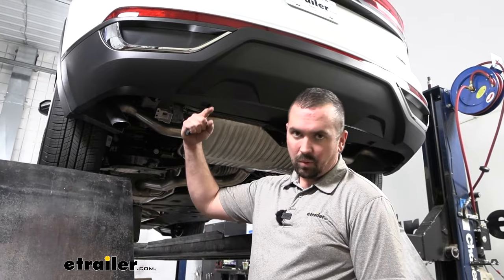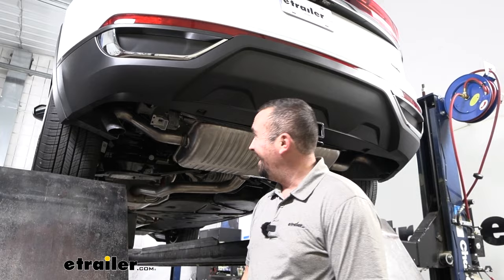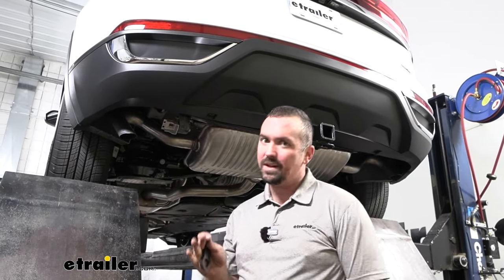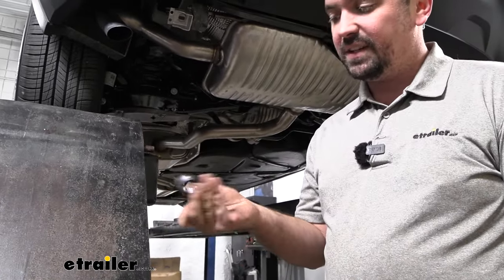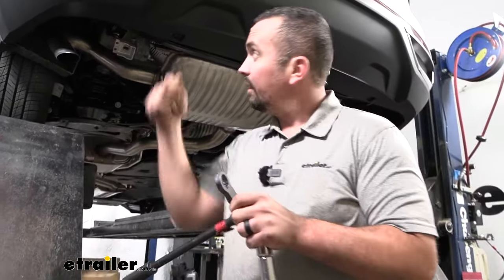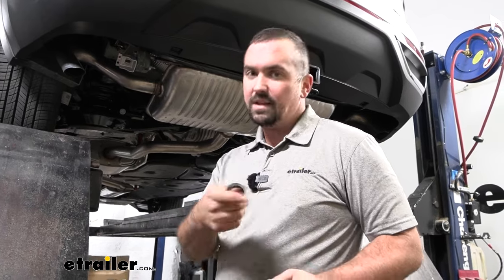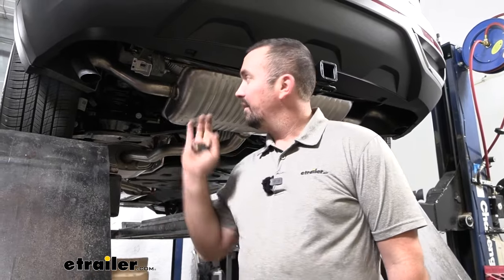That driver's side rear bolt is again going to be a little trouble when it comes to using a torque wrench — getting a standard socket and torque wrench in there is probably not going to work out very well. The best way to attack it is by using a crow's foot attachment, which goes on the end of the torque wrench and allows you to slide in there. You'll have to reset it a few times. It gets a little tricky, but what it comes down to is making sure it's at or close to that torque setting so that it's going to be safe.